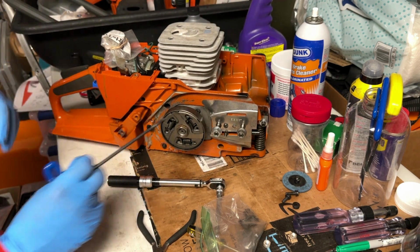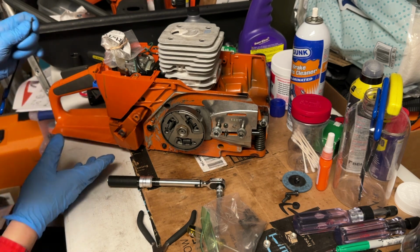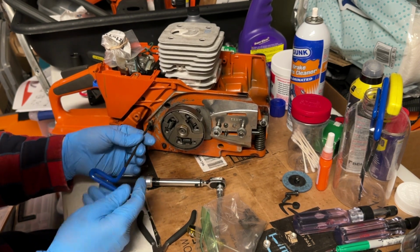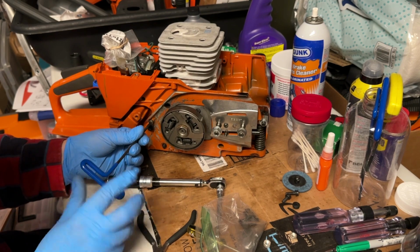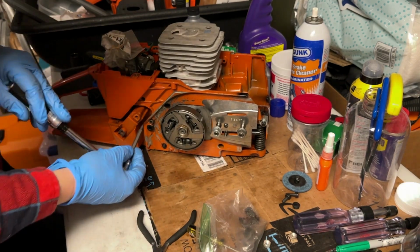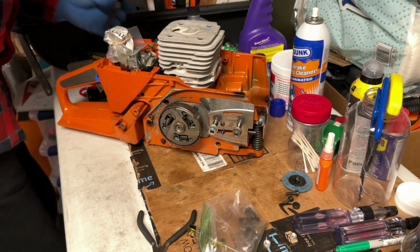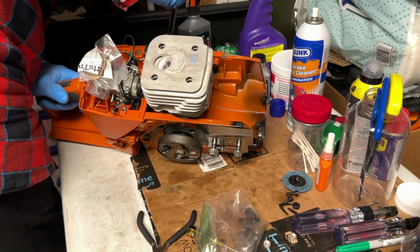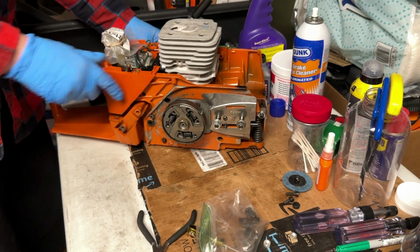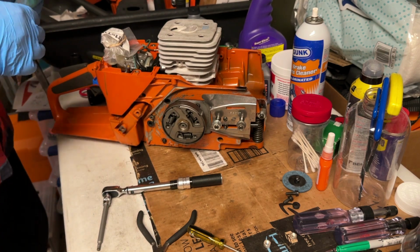And because they are acting as a stop in those two receptacles, you can't put them on until the tank is in place. Again, those are supposed to be 5 to 6 Newton meters. I'm just going to go ahead and verify that that's what I got. We're good there. So the tank and AV mounts are installed.